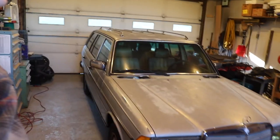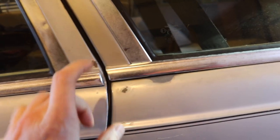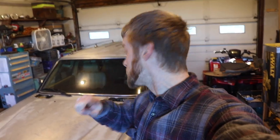That's going to do it for the fluid film application. Got the taillights back in the car — that's done. Underneath the trim there was actually a little bit of rust; I lifted it up with a straw on the fluid film can and sprayed it in there. Any rust that was too difficult to get at on the body, I hit with fluid film. With the Mercedes diesel wagon we're getting it closer to being road-ready. Stay tuned — next video we'll be working on buffing and waxing the paint to protect it as best we can.